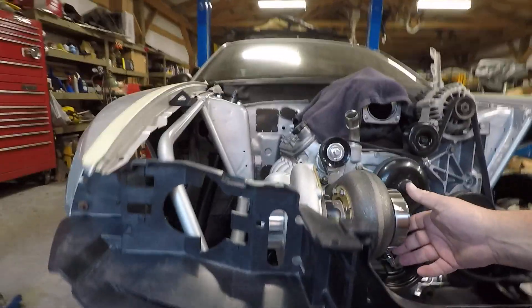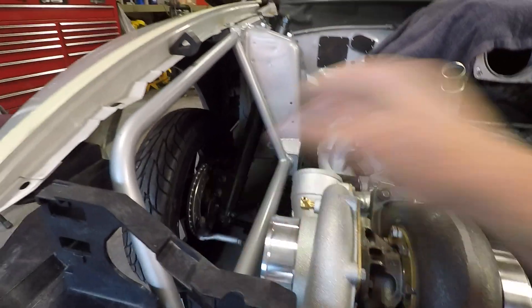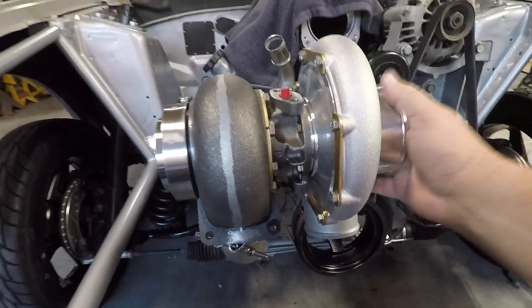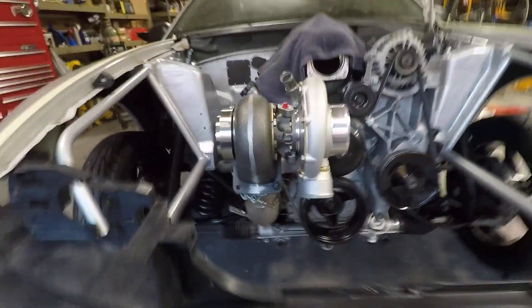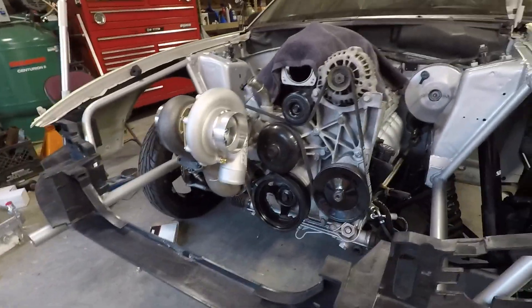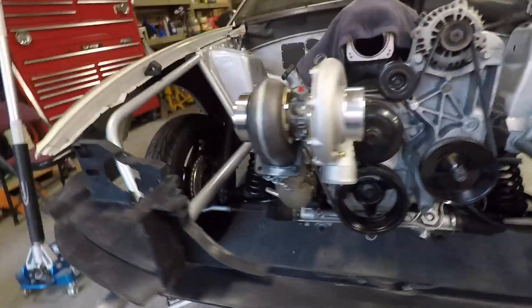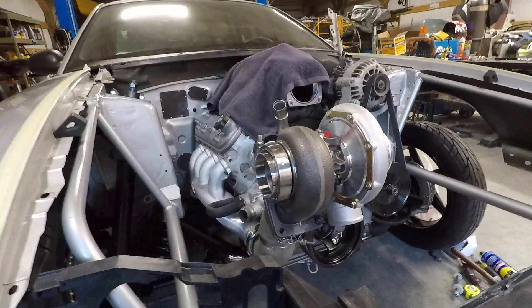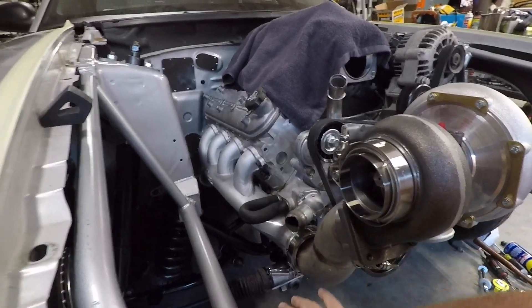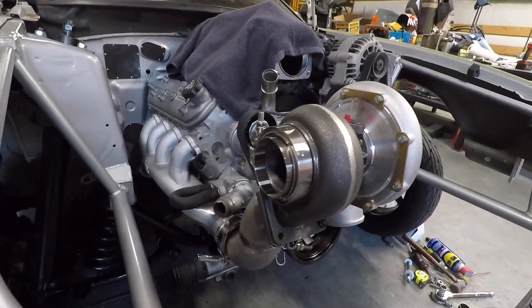Okay, here we are as an alternative. I've got everything on the V-bands so I can move it around and look at it. So as an alternative, that's the other option. That gives me this kind of placement — exhaust would probably come out here. I can still get it turned down and get it underneath the car without going over the frame rail. I kind of like that.